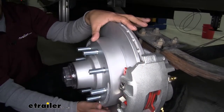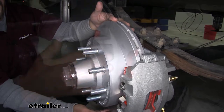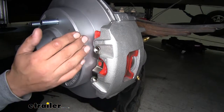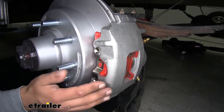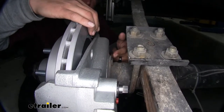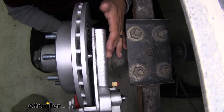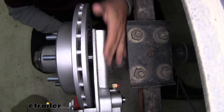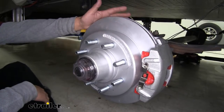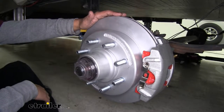Our disc brakes really only have one moving part — the piston inside the caliper — opposed to drum brakes which have a lot of different springs and moving parts. Our hub and rotor are integrated together, made out of cast iron, which helps dissipate heat along with the vented design. Our calipers are also made out of cast iron to prevent flexing, meaning torque is actually applied to the brakes for a smoother result. The brackets are also made out of iron and feature a side support ensuring weight is on the bracket rather than the bolts. Each component has a corrosion-resistant finish rated for 300 to 400 hours of salt spray in fresh or salt water environments.